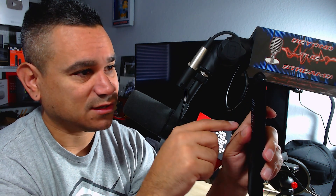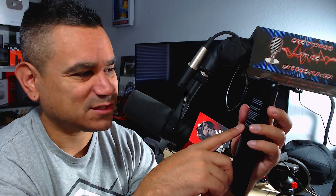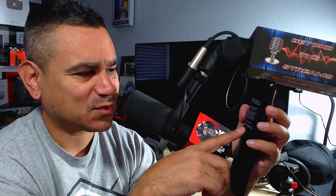Press and hold OK for three seconds until the LED turns solid — the remote enters learning mode. Press the key you want to program; the LED begins blinking. Then aim the remote at the front of your TV, about three centimeters away, and press the corresponding button on your TV remote. If programmed correctly, the LED will flash three times then turn solid. Repeat steps for the source key. To exit learning mode, long-press OK for three seconds — the LED flashes twice then turns off.